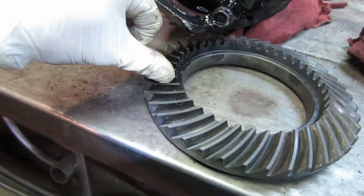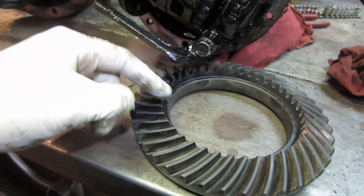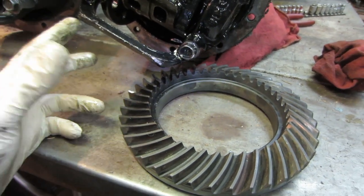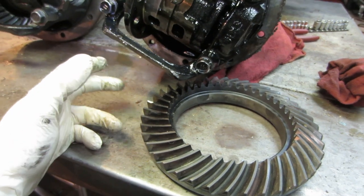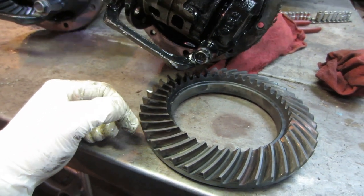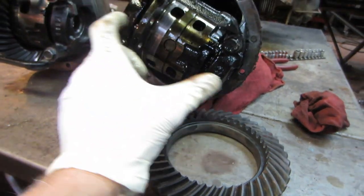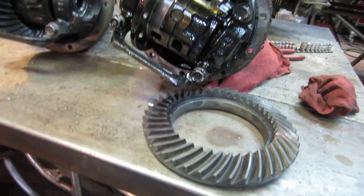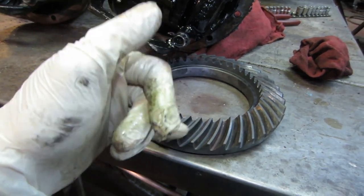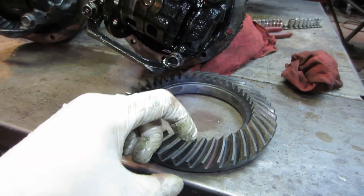And then it rubs a certain pattern on the face of the gear for longevity, noise, etc. So it's an art in itself, setting that stuff up, shimming them correctly, getting them to mesh just right. You rub an ink on the side of them, you run it through the gear, you run it back, you see where the wear pattern is, you shift it around.